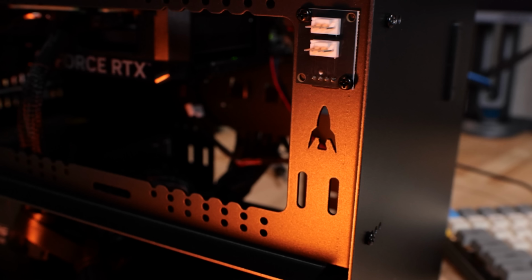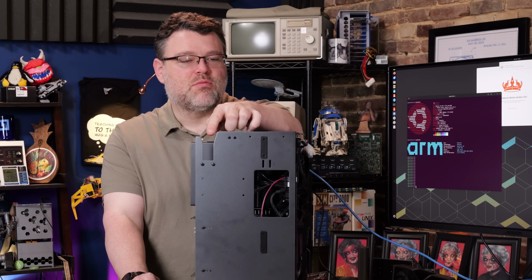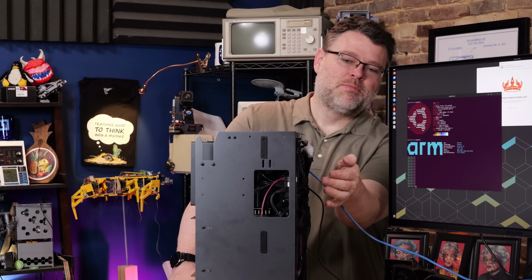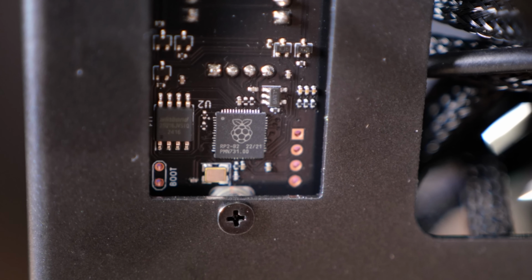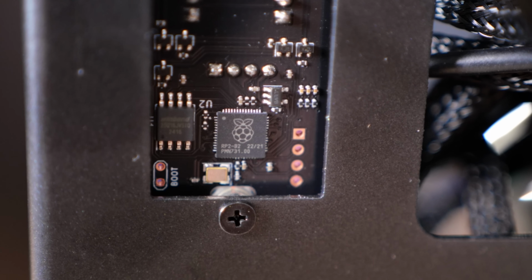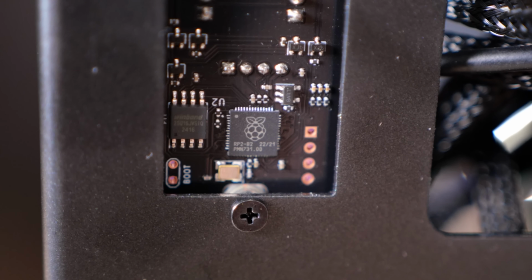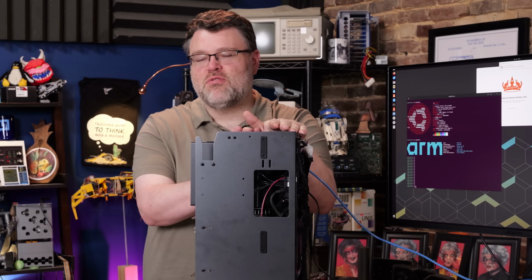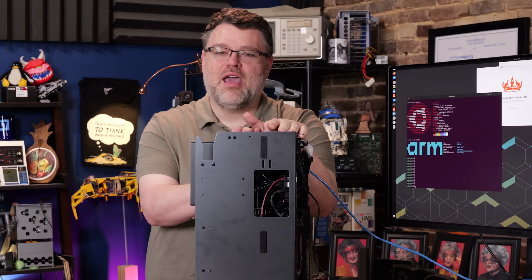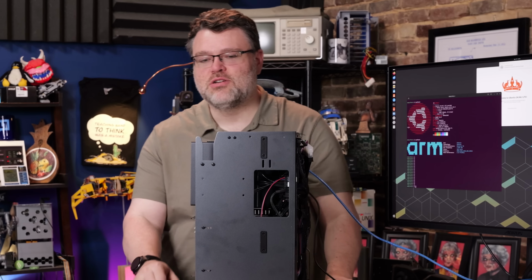Printed circuit boards that distribute fan control and will read from the fan headers, and the button interface with the pogo pins and other things like that. So if you check here on this side, there's a PCB with a microcontroller that's doing some heavy lifting to improve quality of life when you use this case with your motherboard, so that you can have more distributed fan control. A lot of the time on these server motherboards, they're configured to make sure that the fans scream all the time, and that is not necessarily what you want in a more desktop/workstation configuration.